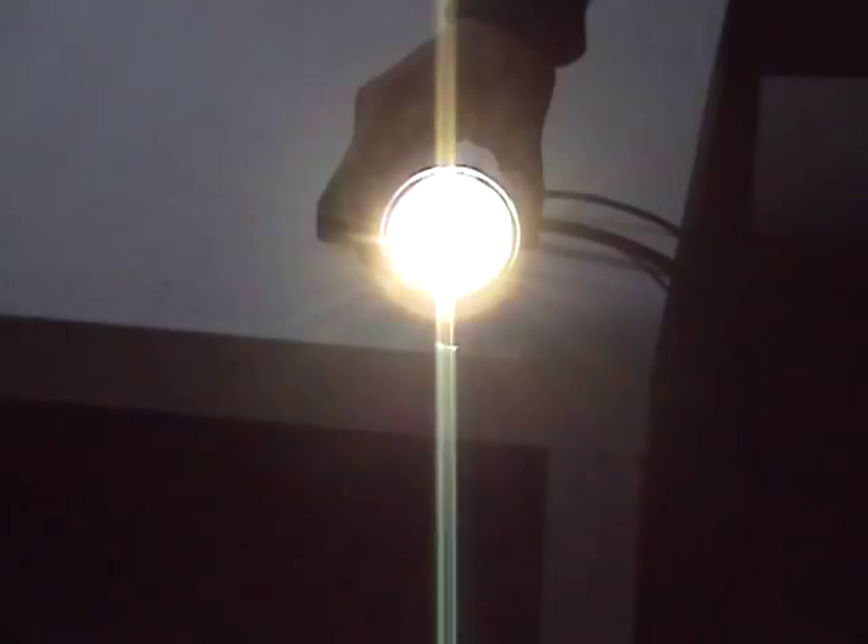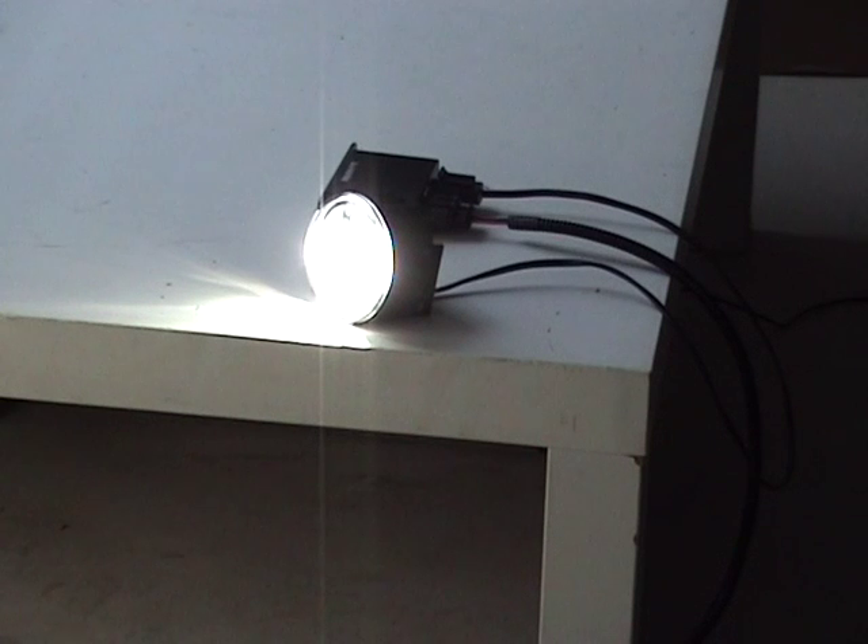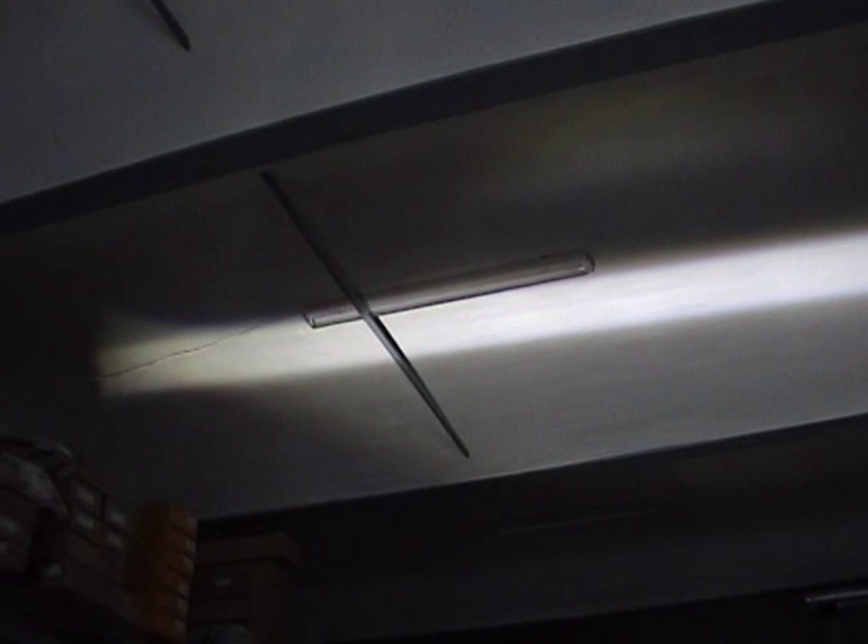These are the fog lights — pure LED, German made, super high power. If anyone ever wanted a focused fog beam light, it's not going to get much better than this. This is about 10 to 15 meters away, and look how wide that light arc gets — it just keeps on getting wider the further the light gets away. But even at that distance, it's still keeping absolute crisp edges and a nice beam pattern. It has even the beam pattern that goes underneath the light — you'll see that light arc where it dims down into a bowl underneath the main beam, and there's no scatter even off of that. That's all part of the parabolic lens design for this particular light.